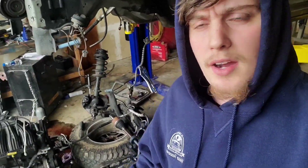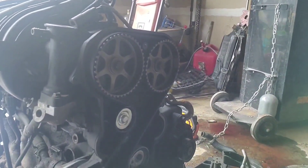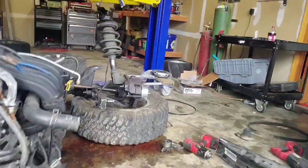Don't mind the mess. I haven't been recording all the updates on the PT, but as you saw, the motor was out. We actually got the timing belt all taken care of and the water pump is all on. We pulled the motor and transmission out of the frame, got the transmission disconnected, got the clutch out, and we're just getting ready to put the new clutch in.